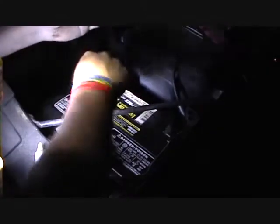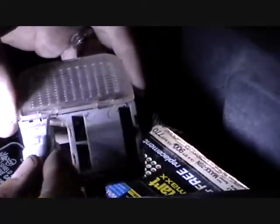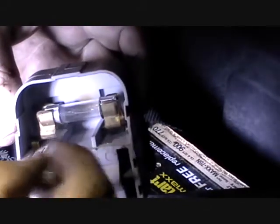The way you take this off: there are little spots right here where you can put in a flathead screwdriver. Use something a little bigger than this and just pry it up a little bit at a time, and then this will come off. You can check your light bulb — as you can see, there is some discoloration in the back, but it's been blown out before and replaced. The filament is still good. Let's snap all that back.